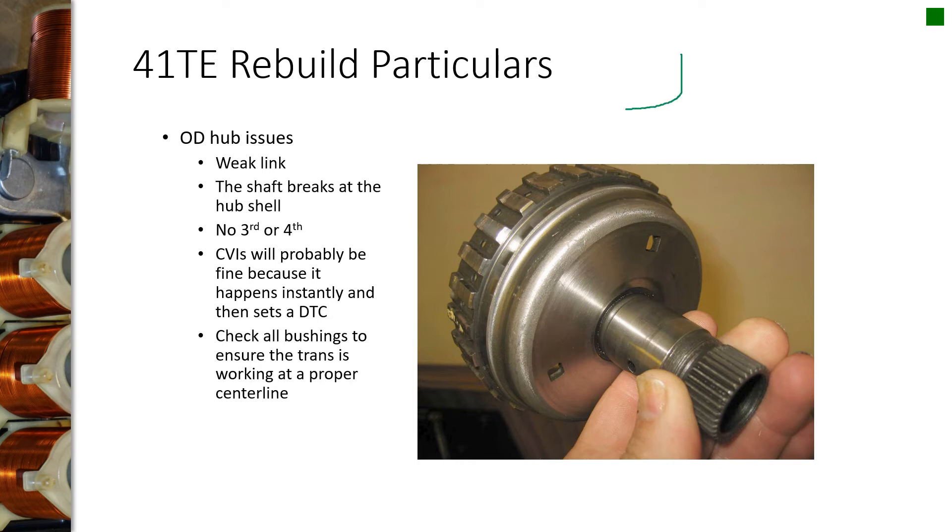It's always that inside corner — the outside corner being sharp doesn't seem to make a difference. But the inside is where you want that radius. They may not have room for it because of some bushings and bearings that fit there, but they really need to figure out a way to do it. They don't break as much anymore because they have updated this hub and it's a lot better.